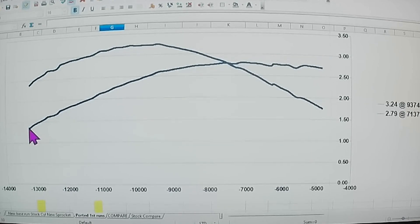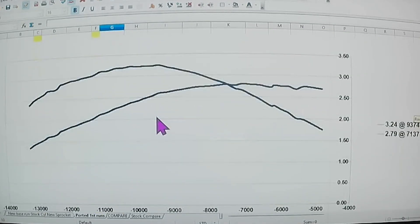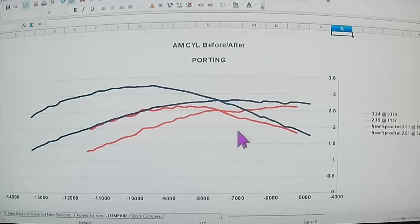It didn't stretch out farther here. 13 to 11 was what I could get it to, with a foot-pound and a half of torque give or take. It done considerably better. The red line is stock, no modifications at all, base gasket, just out of package. The blue line is after porting it some - not going too extreme, but porting it and cutting a little off the base, getting the squish set down. Sure made it a pretty decent saw, but it still didn't do as good as I thought it should.